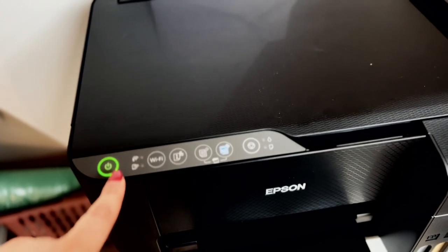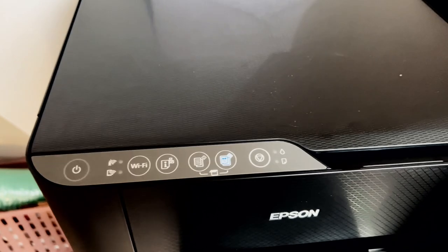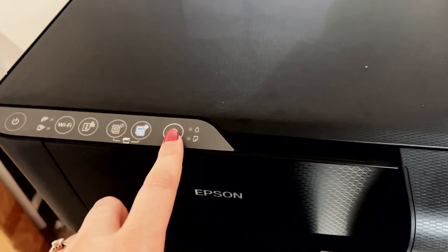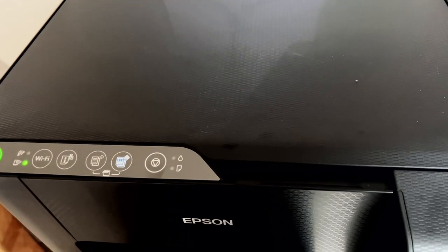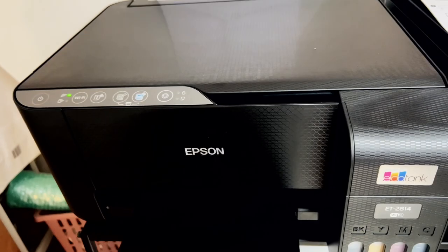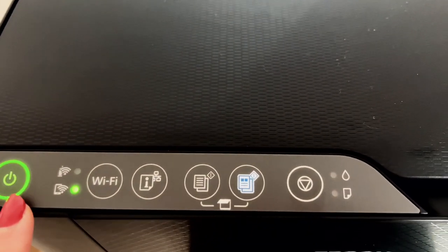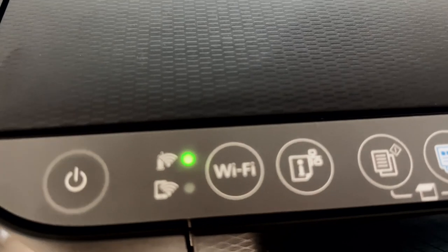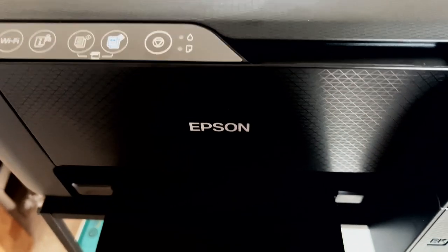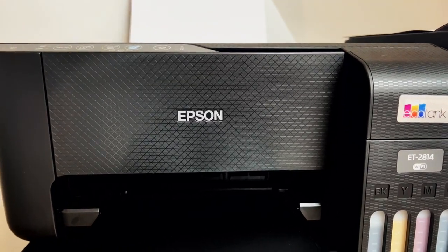After these 11 minutes — which I've skipped — you're going to turn off the printer and refill it with some regular paper. Then you need to press the triangle button and the on/off button both at the same time for five seconds. This will trigger a test page. We're going to print out a test page and check if the lines are all nice and clear. This is really important — if you notice any gaps or hiccups between the lines you need to correct them, because otherwise your final image will have missing or broken lines.